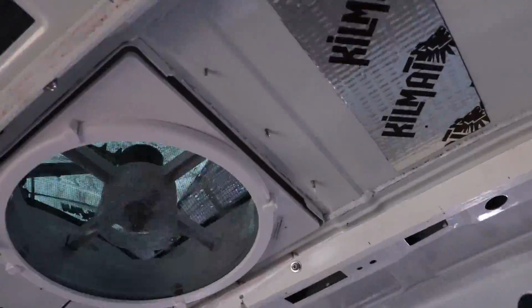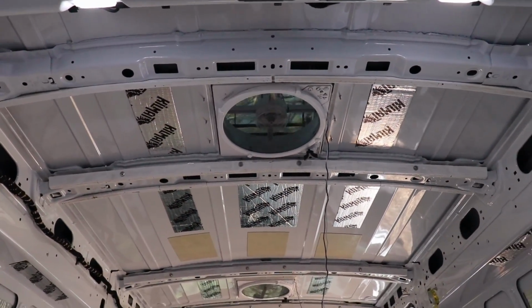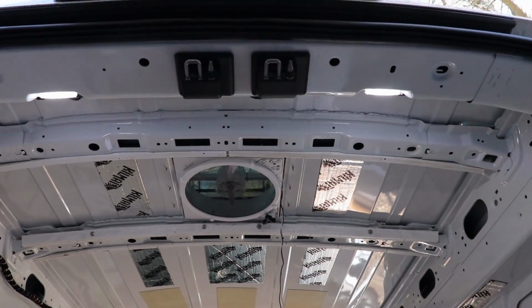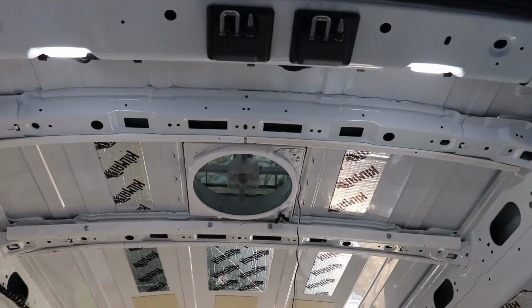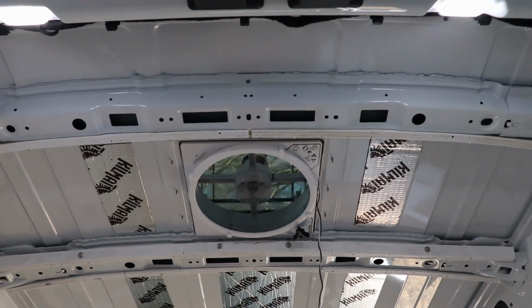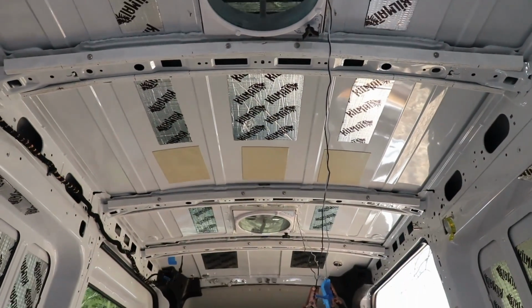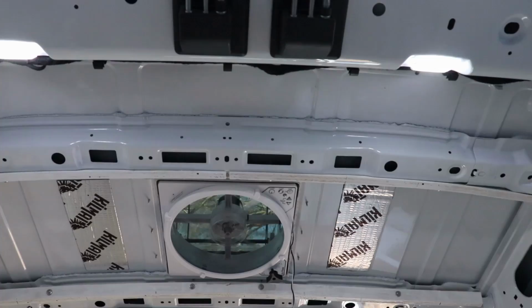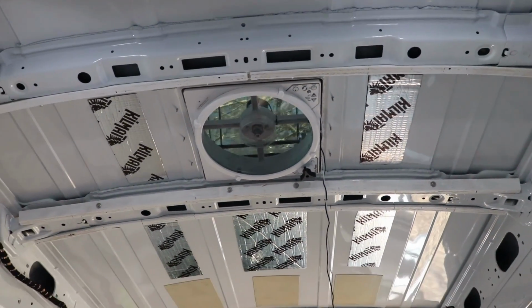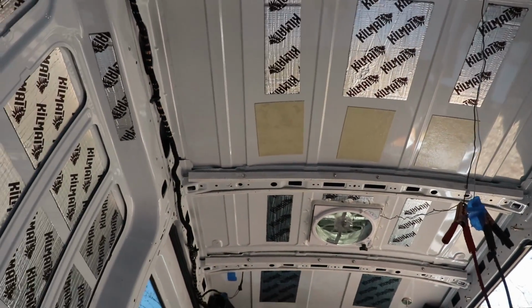You got the skylight. Check it out. The MAXXAIR fan install went very smooth. You know, plan, prepare, and execute. We measured four, maybe six or seven times, and thankfully had to only cut once. My template that I made it just shy of 14 inches square at 13 7/8. And when I drew it, I cut the line and it fit like a glove. There wasn't any slop or excess for it to, you know, have any seal issues.